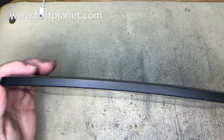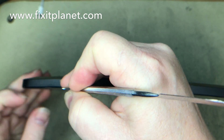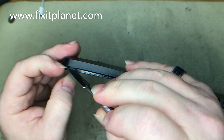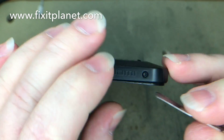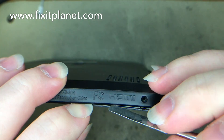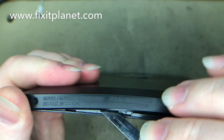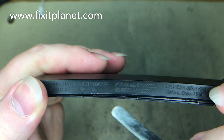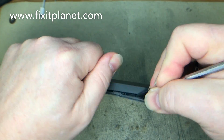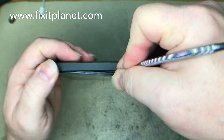In this particular case it's cracked, and we're going to be replacing only the front glass — the touchscreen itself — not the display. There are some little indentations where you can get your tool in to help pry out the midframe and get the back off. If you only need to replace the display, be careful because the digitizer cable is very close to the edge, and running your tool through there can damage it.